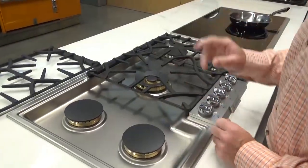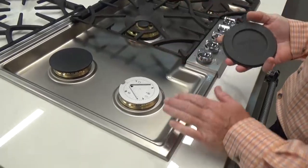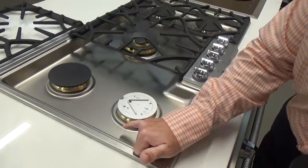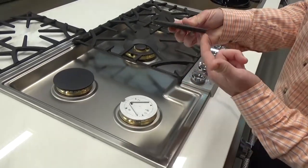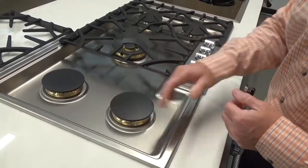And then on top of that, I talked about the low of 850. The way that we accomplished that — and what I like about this burner — is the gas is going to flow here and obviously be ignited. So instead of it coming out of these lower ports on the bottom, it's actually going to ripple around the outside of this cap to get us that 850.